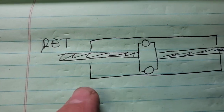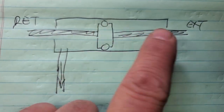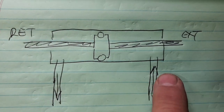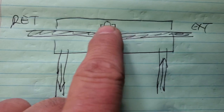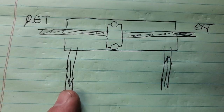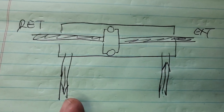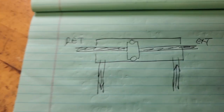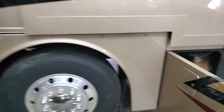So this is it. There's a hydraulic line. The fluid pumps into here, sealing inside the cylinder, pushing it this way — which would be retract. That's the inboard. The hose is outboard — it's always the opposite. The fluid gets pushed out back into the reservoir. The cylinder goes this way, squeezes, and the fluid comes out. Now the opposite: if you're going to extend, you're at the other end — the inboard — because you want to take the slide outboard. You push the fluid this way, it pushes the cylinder over, and the fluid in that area gets pushed back into the reservoir.